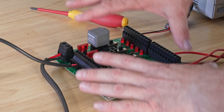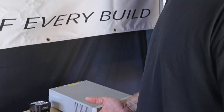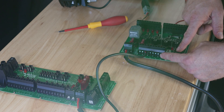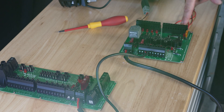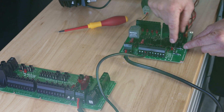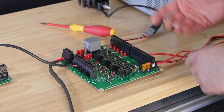If you set all of this up this way but have one circuit you want to run off the start battery — for example driving lights — you could leave supply five fuse out, run a start battery feed into here, put a relay in, connect your driving lights to load five, and then use a high beam trigger through a switch connected to switch input five. You could then use circuit number five to turn your driving lights on and off.